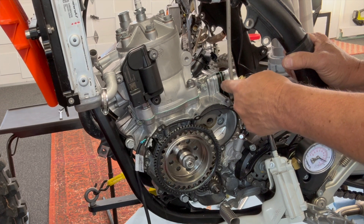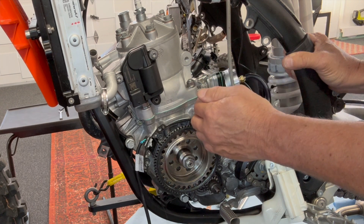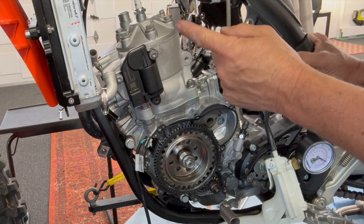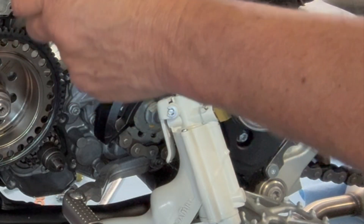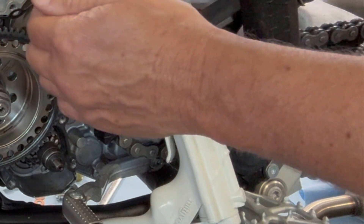Keep in mind that a small vacuum leak isn't a big deal when things are wide open, because there's not that much vacuum — things are processing really fast. It's the low throttle openings where you're doing small blips. That's where you have high vacuum, and you suffer and lose response.